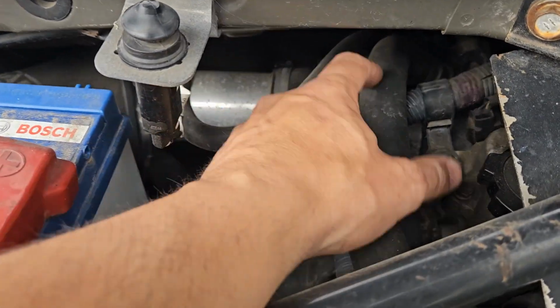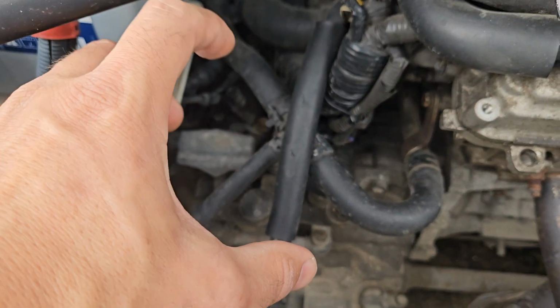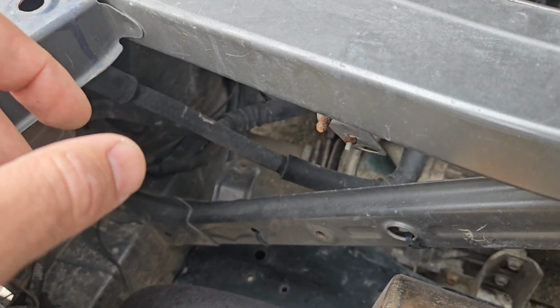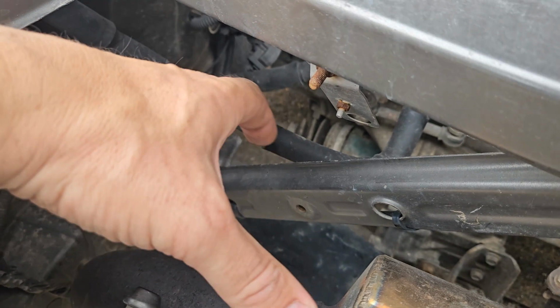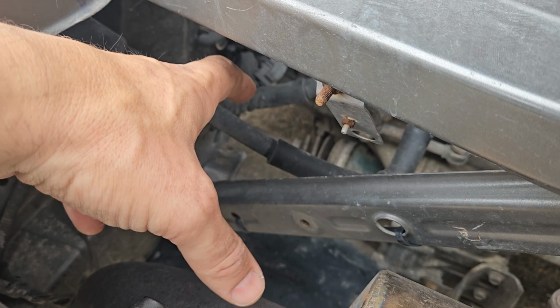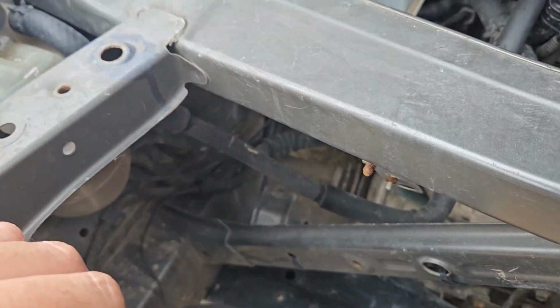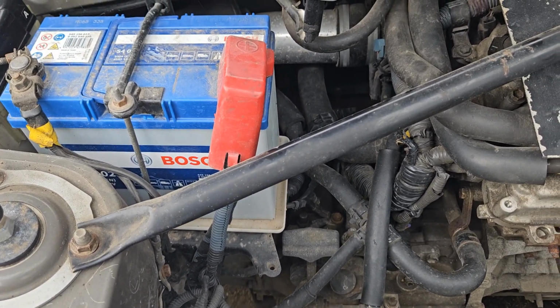Normally the intake comes around down here, and you have the airbox sort of here. Now, one of the things you can do as a little upgrade if you want is out the back of the airbox, which normally sits here, comes around here. The intake size goes from, I think, 3 inch down to 2 inch. So you can take that little bit of plastic off. I routed another bit of plastic sheathing over the top when I did mine. Just something worth having a look at.